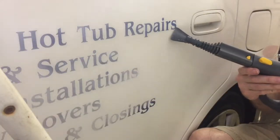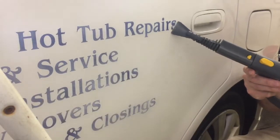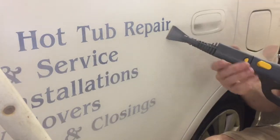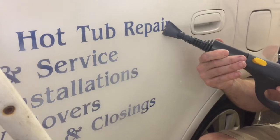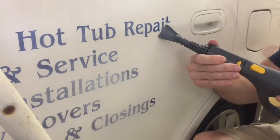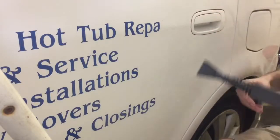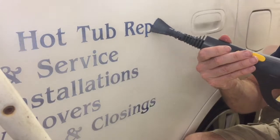Clear coat is damaged at 140 degrees, so set it at 100 degrees and you'll be able to blast off these decals in no time. These are old — they've been on for years in the weather and direct sunlight, they're baked on.